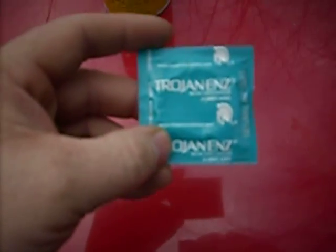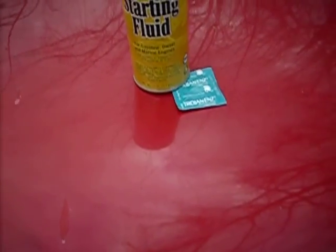There's the tool we're going to use: a very simple condom — a contraceptive. I know you're wondering how you're going to use a condom as an automotive diagnostics tool. We're going to put the contraceptive, unraveled of course, over the mouth of the radiator. We're going to take the overflow hose and crimp it to prevent loss of combustion gases if they're getting into the system. Then we're going to start the car. If we're getting combustion gases into the coolant system, it should inflate the condom like a balloon. If not, then really nothing should happen.